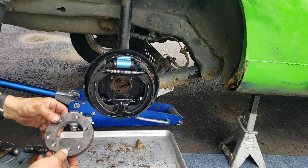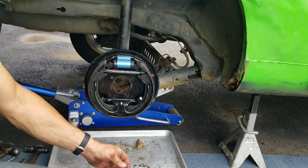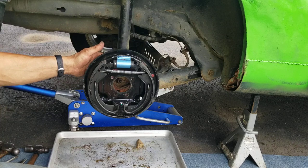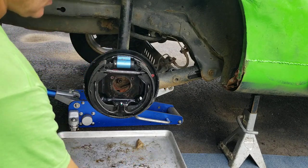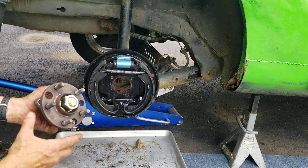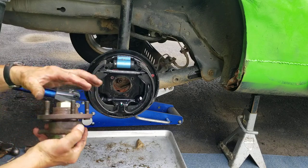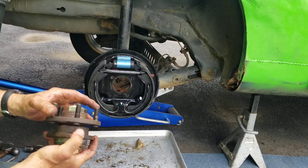In your kit, you're going to receive the adapter, four bolts, 1.5 inches long to attach the adapter to the axle, and three bolts, 1.25 inch long to adapt the wheel bearing to the adapter. It's highly suggested that you use an original GM bearing, which is what we're using in this case, or Moog, as aftermarket suppliers generally aren't as strong.